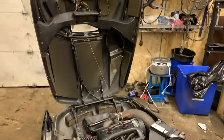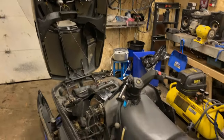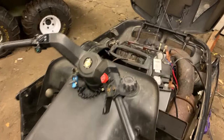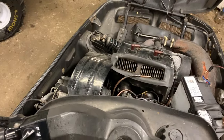I'm gonna grab the booster and see if this one cranks. The fellow said he wasn't sure if she had spark and she didn't want to run. So I got my little battery charger on — you can see she's just plugged in there. Let's see if she'll actually pull over for us. Okay, that's not a good sign. I think she's stuck. Since we got the battery charger on, turning the key — yeah, we got some binding going on. Let's go have a look, this might be the starter motor.